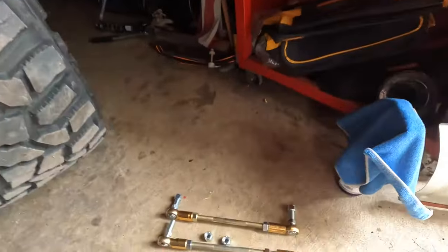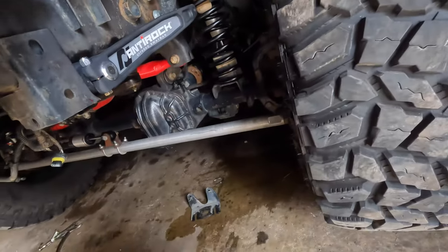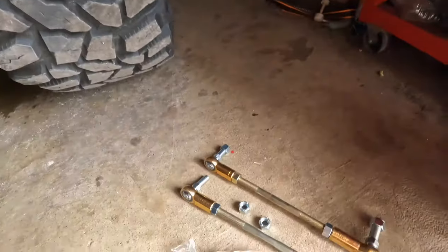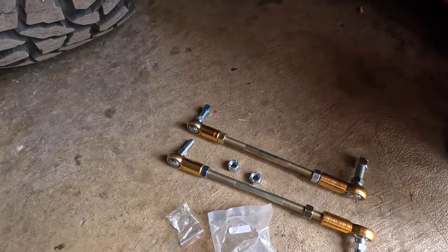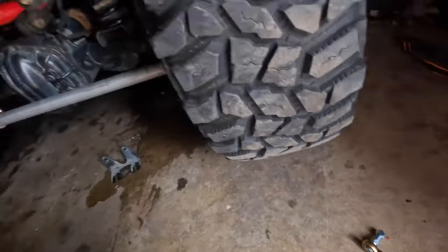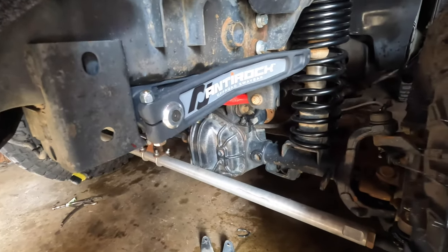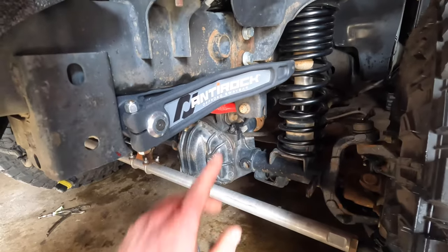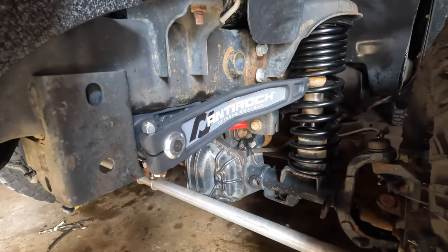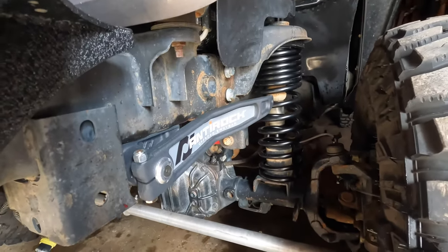Normally next you'd put on your sway bar links, which I have right here. However, the ones that come with the JK kit are not long enough for my application because I have about five inches of lift in the front. So I had to go on to Northridge 4x4 and order new sway bar links - I ordered the 14-inch ones so that I have plenty of rod. Those were about 20 bucks a piece, which kind of sucked, but that's my fault for not researching before I bought it. Good news is the rest should be finished later today once UPS drops off the links. I do plan to angle this up a little bit more than usual, which means I may have to trim here as well.